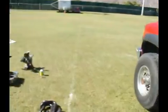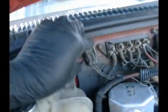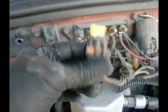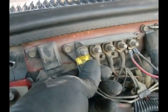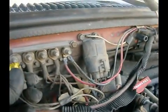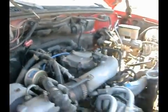So with 2 minutes left on this chip, watch this. I just learned a lesson from an expert former GM mechanic. Here's the fuse for the fuel pump. There's the fuse. Just push it against any one of these positives. A little spark. There's the fuel pump. Fuel pump relay is not working, and they're all the same, all the GMs. Got that fuel pump cranking away. Should be primed by now.